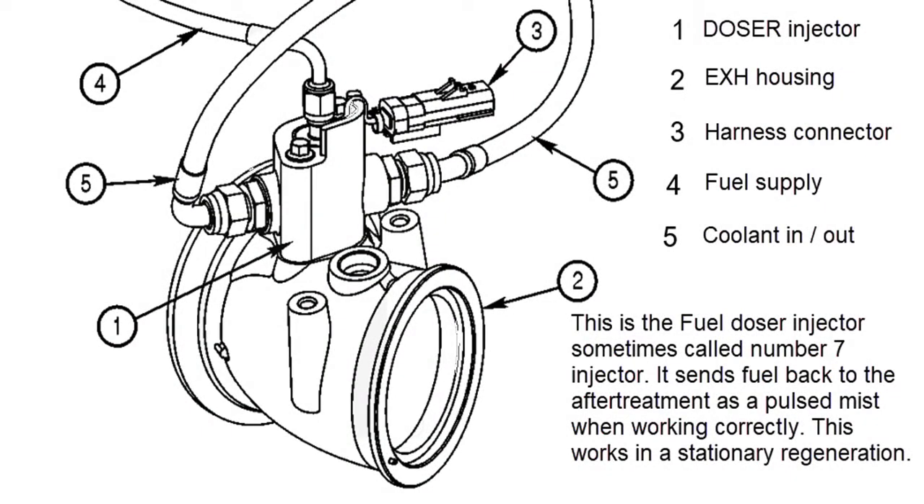This is an illustration of how the injector bolts up. The red arrow hole won't be there — that hole was for an oxygen sensor, which is not on the H-71 system. The green holes might be there; those are for a heat shield that you can bolt on, so it may or may not be mounted there. It's a pretty simple setup — the doser injector bolts on with a couple of bolts and you've got a plug that you plug in.